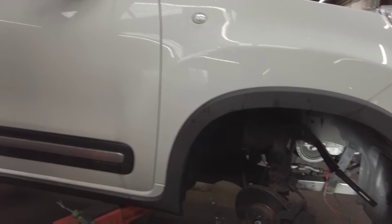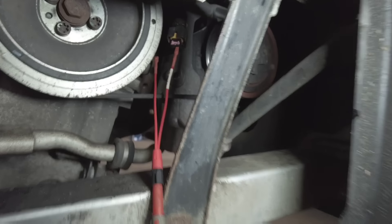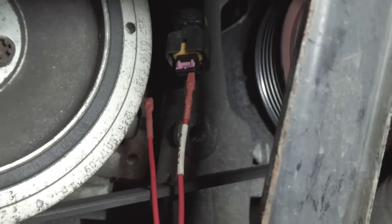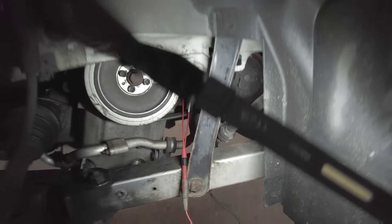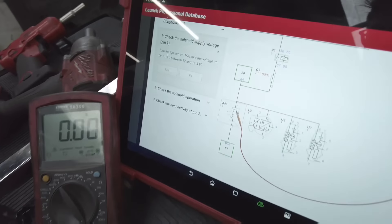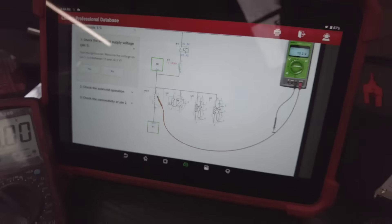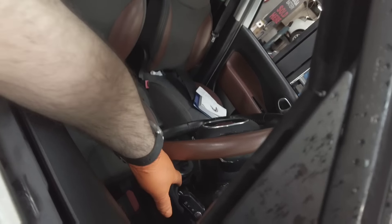To carry out this next step I need to drop the vehicle down so I can get to the key and turn it on and off. We've used our breakout loops — I do like to check at the pins rather than back-probing just to make sure everything is working as it should. We've got our multimeter coupled up with a good earth connected on the engine, and our diagnostic procedure is telling us to check pin one for 12 to 14.4 volts.